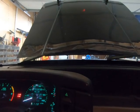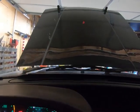So ideally you want your car running at 180 all the time. And it's getting close to the edge there. I don't know if you guys can see that. Yeah, it's hard to see. But ideally you want your car running at 180 the whole time, but that's more of an ideal than reality. You can make it reality, but the reality is 240 is hot. You probably don't want to be running at that temp non-stop. Oh boy, she's getting high.